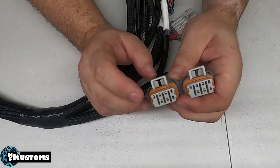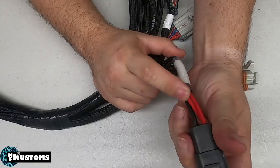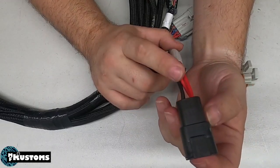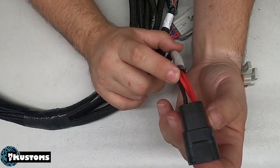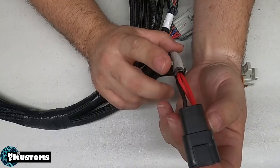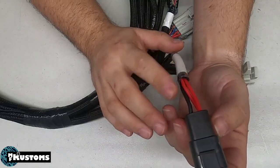This is to allow us to run 12 gauge wire, which isn't really needed for all scenarios, but it does allow for people to run, say, methanol fuels, where you're going to end up running your dwell times very high. So we just go ahead and build these out so they're 100% ready for pretty much any scenario.